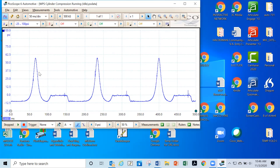After we have power in the cycle, then we have exhaust. So this is the exhaust side. Then we have intake again, and then we have compression. If you want to go the other way, you can say intake, compression, power, exhaust, if that helps you remember it easier. So then you would start here: intake, compression, power, exhaust. It doesn't matter where you start. It's always going to cycle the same. Just remember, this side is always going to be the compression side, and this side is going to be the power side. Compression, power, compression, power. So we've got power, exhaust, intake, compression, power, exhaust, intake, compression, power, exhaust, et cetera.